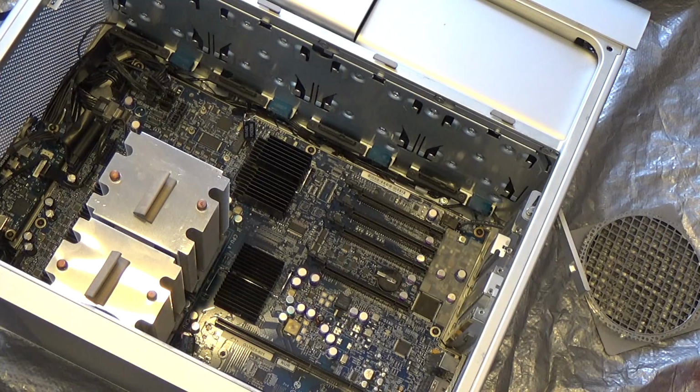If it's heat conductive, probably copper. Let's see if it says here what is actually in it. See if I can find an ingredients list. I don't think it ever dries out. It washes out well with alcohol, I know that. Anytime you remove these heat sinks, you're supposed to reapply it. Plus, this computer had gotten water damaged and mold and mildew damaged, and when I took them off, there was thermal compound still there. I was afraid that it had all gotten washed out, but there was still thermal compound there. I'll come back with a little more video when I get a little bit further along.